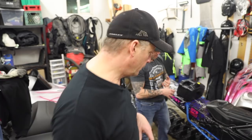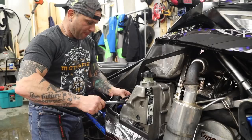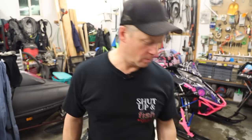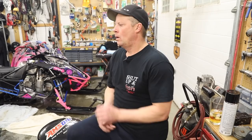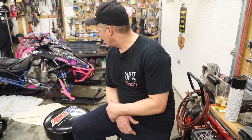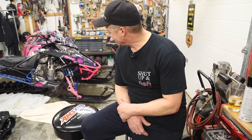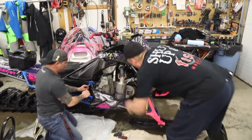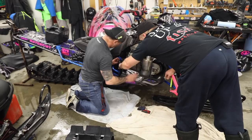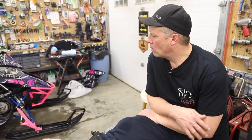Now you can put it back on the stand. Take the chain case apart, take the snap rings off so we can get the sprockets off. Then we'll go around the other side and take the caliper off. You need metric tools on a cat — built in the States and I have no idea why everything is metric. I hate the metric system. So make sure you have the right tools: metric wrenches, metric sockets, metric Allen wrenches. You also need some Torx — T-O-R-X — snap ring pliers, and chain case oil. Should be about a four-hour job if you're taking your time.